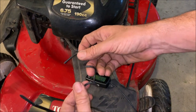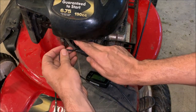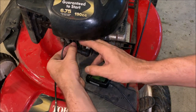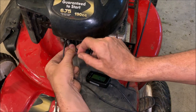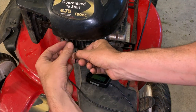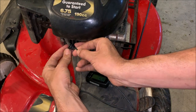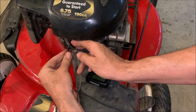To install it, you do need to wrap this cord on the spark plug wire — at least three turns; I try to do four or five. Once you get it wrapped on, you need to secure it, and what I find works best is just a zip tie. Usually I don't keep these on my machines — I just put it on temporarily when I need to adjust the speed, make the adjustment, and then take it off.